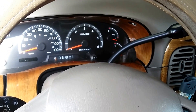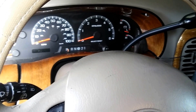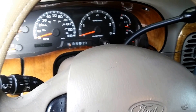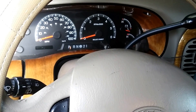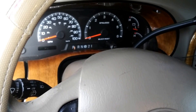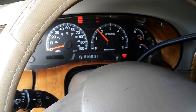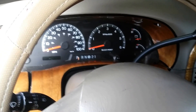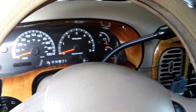There's no clicking. I was in a rush so I didn't have the video showing what the clicking noise sounds like. What was going on is: I'd turn the engine off, take the key out, and the engine was still running. Now that I've replaced the ignition switch, I can turn the engine on and turn it off — no accessories are on, nothing's running, no blower motor, you don't hear any clicking.